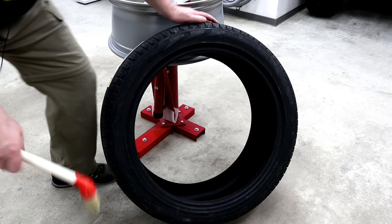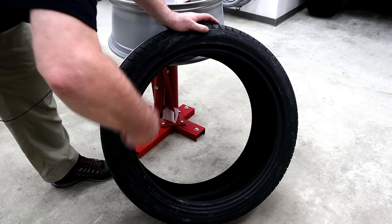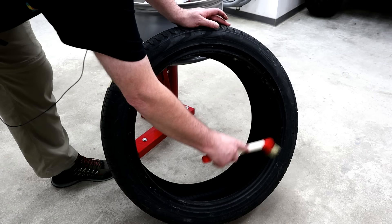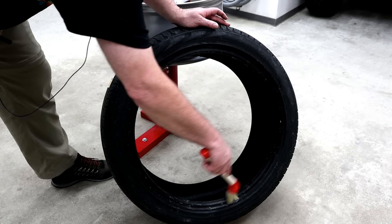Before mounting the tire we've got to lube it up. I like using a paste lube for mounting and a liquid lube as we saw during the dismounting video, just so there's no liquid that's going to be trapped in the tire after it's mounted. These cheap eBay brushes are garbage — the little hairs shed on them, and if you get a hair between the bead and the wheel seat it could slowly leak air. I should have just used a good old paintbrush. Of course, do both sides.